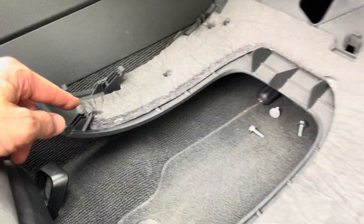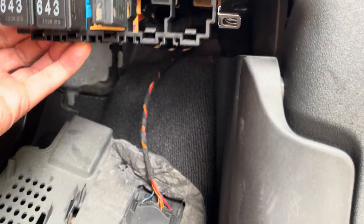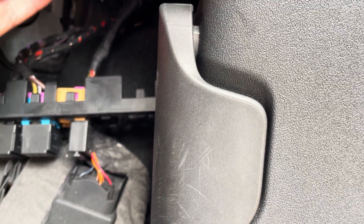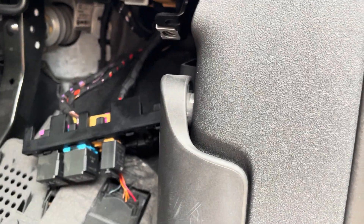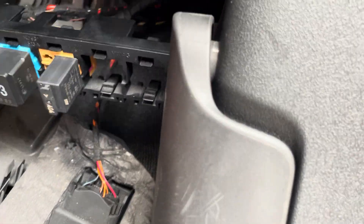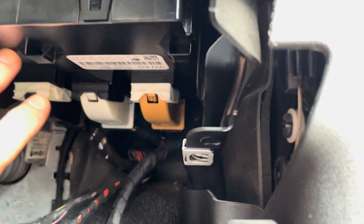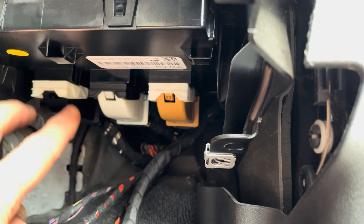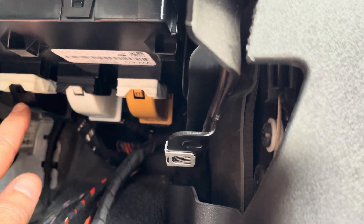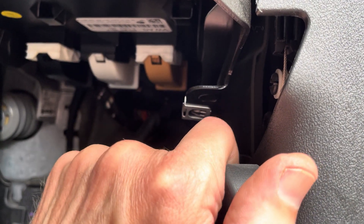To access the BCM, remove this panel — it has a couple of bolts and clips — and carefully ease it out. You need to remove the plugs from the light switches on the back, and there's also a relay block that clips in here, with small clips underneath you can slide out or take the relays out the front and press the clips. Take photographs of everything as you go. Once you have the BCM accessible, disconnect the three multi-plugs by pressing the small plastic bit and levering the white bit down — they're quite stiff with a lot of connections, so take your time.